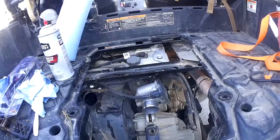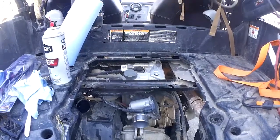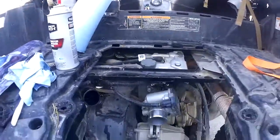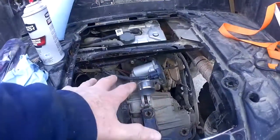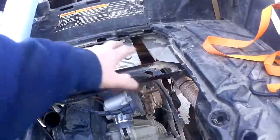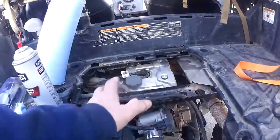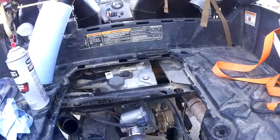I watched some videos online about cleaning the Razor throttle body on my 2017 570 Trail. It's not that big a deal. Before you remove the air box, spray the throttle body — all the throttle body and everything — to get rid of any excess dirt or material.